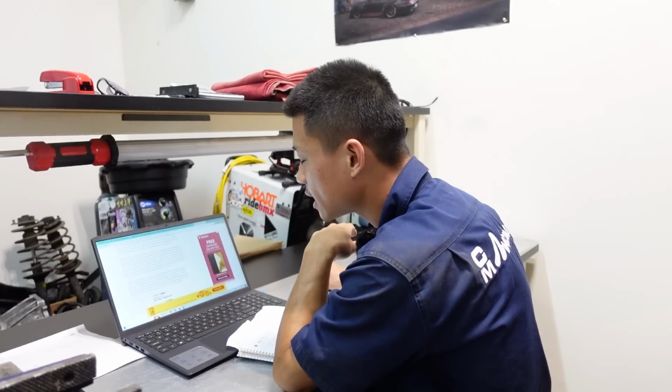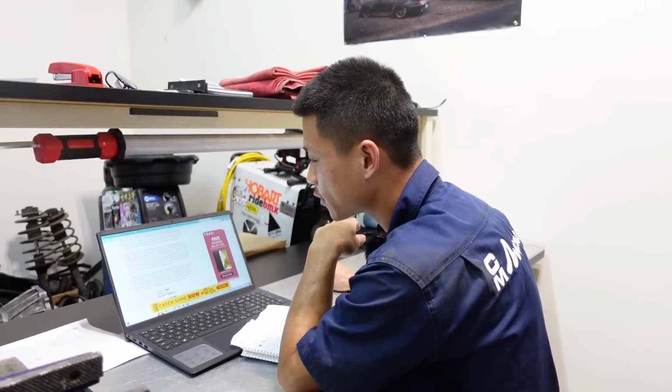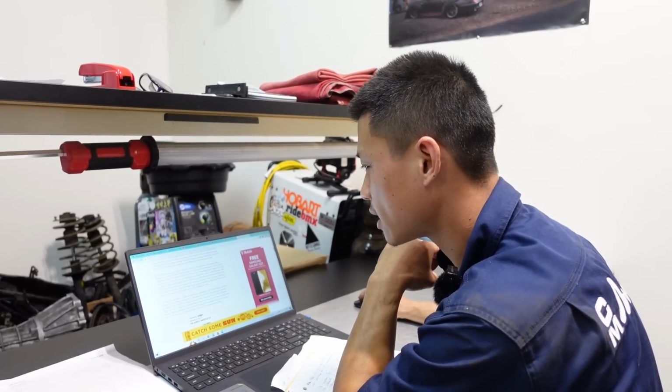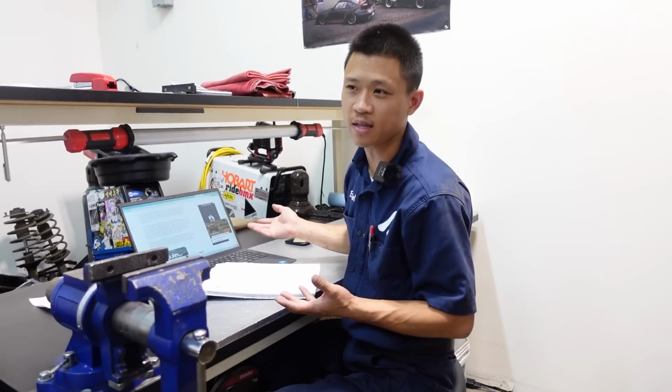So you can imagine, just from what I said, this engine's full of silicone, or I should say sealed with silicone. Hopefully it's not full of silicone. Allegedly applied too liberally at the factory. I would agree. When RTV is dislodged in the engine oil, it can clog the pickup, cause oil starvation, and ruin the engine. Agreed. I've seen it. That's the gist of the article. Pretty much just Toyota's not covering the engine replacement on that car.